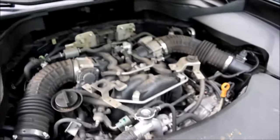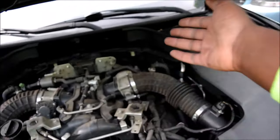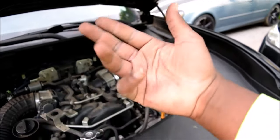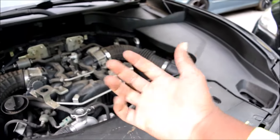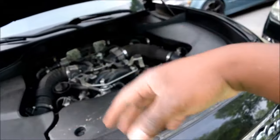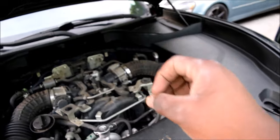You have so much coolant in your car right now — in the engine, the hoses, the heater core, the radiator which is below this intake cowl. The purpose of coolant is to take away heat that comes from the combustion process. That heat is sent into the coolant, and the coolant loses that heat through the radiator — and also inside the cabin through the heater core — but the radiator is the main part where you're supposed to lose heat.